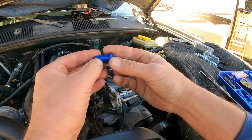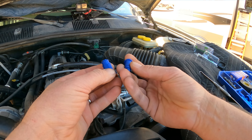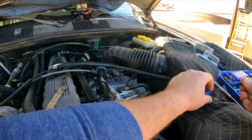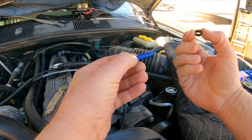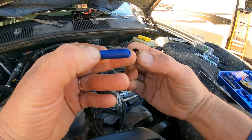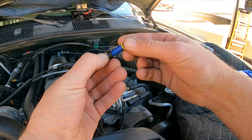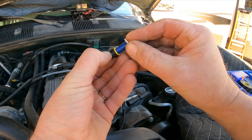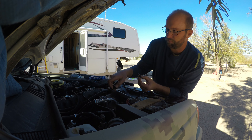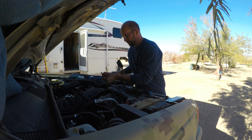So to install obviously creates its own issues, so I had to make install tools in both 5/16 and 3/8. The way these work is you'd put the retainer on the same way that it would go into the whole assembly — the chamfered edge of this little retainer clip goes on first. The O-rings in the same order as before with the bushing in the middle, and a little bit of oil. I always use the dipstick — it's a handy-dandy little applicator.